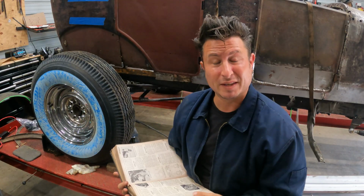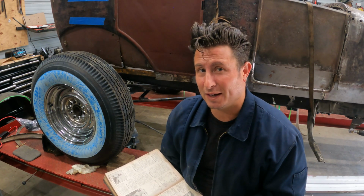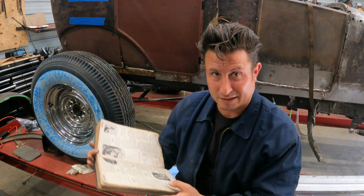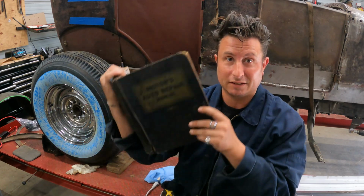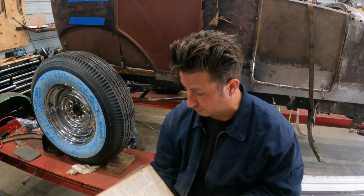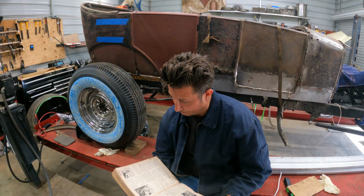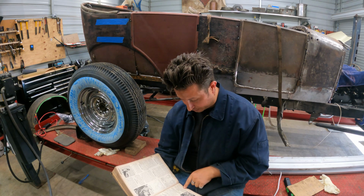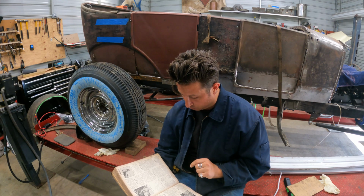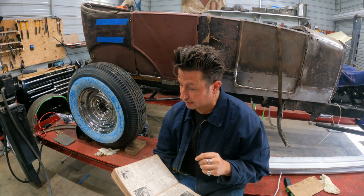Story time, yet again. One of the things about cylinder bore taper is people throw out numbers, but they don't throw out a source. We got a real number on cylinder bore taper for Chevrolet from this 1960 service manual. It may or may not agree with what you know to be true, but I'm just going to tell you what's in the book. In the book, it says, if the cylinders were found to have less than 5 thousandths taper or wear, they can be reconditioned with a hone and fitted with high limit standard size pistons.